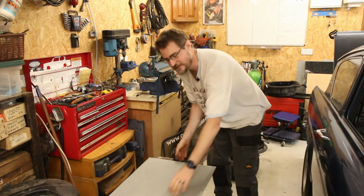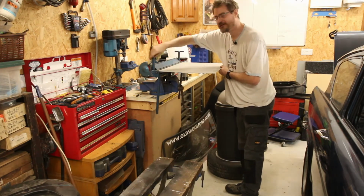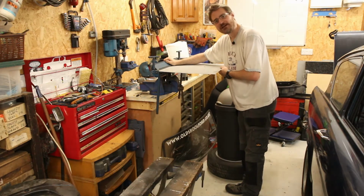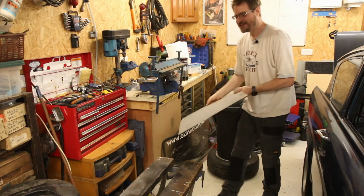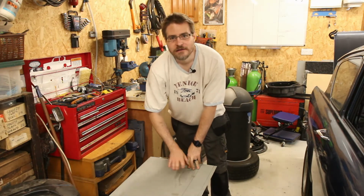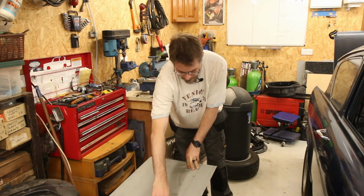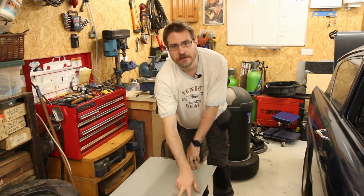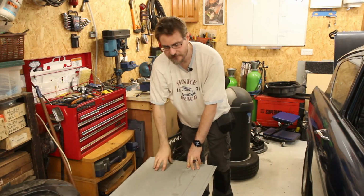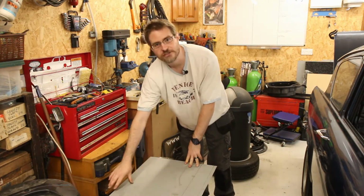And it's too wide to fit in the folder. It will sit between the edges, but these adjustments are in the way. Damn it, and I thought I'd measured that well. So we're going to have to do it a different way, which will probably be clamp it down to the workmate and then gradually tap it down along these two lines here, and that'll give a nice step on it, which will give it some strength in that direction, and then we'll need to figure out adding strength in that direction.